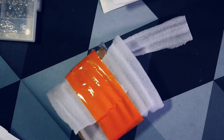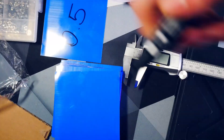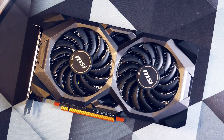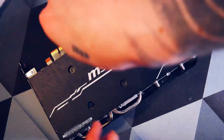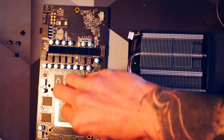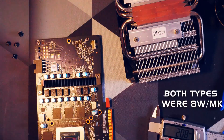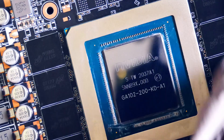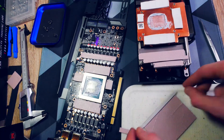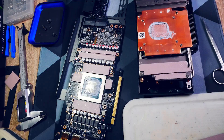Thermal Grizzly pads are a bit more expensive than others, but we are also cooling very expensive tech here. Keep your tools clean and cool and you'll have them for a long time — I'm talking about the GPUs of course. I did a lot of my other cards recently as well, so you can expect more videos like this on the channel in the near future. I also have different brands of pads coming in, so with cards where I have two of the same model I can do direct comparisons of different brands. Today we saw 6 watts per meter kelvin on the back, and Thermal Grizzly's Minus Pads are 8 watts per meter kelvin. I want to see if claims of brands like Gelid claiming 12 watts per meter kelvin are true and if you can actually feel the difference — please subscribe to see more modding and comparisons like that.